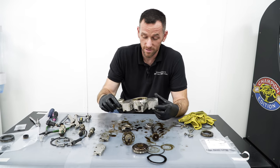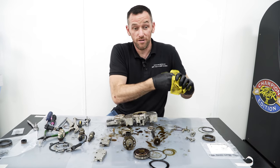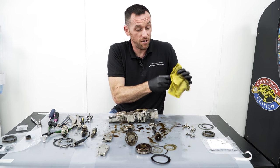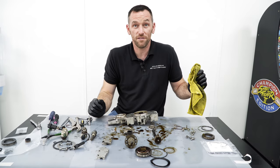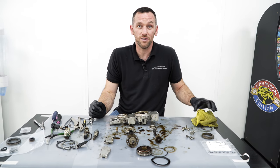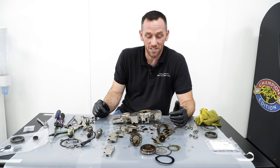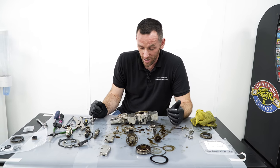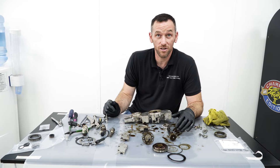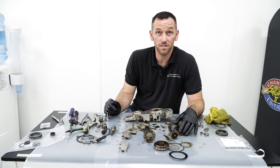They were cheap at one point. They were incredibly cheap. I remember doing these and people spending £1,000 on the VANOS unit and they were selling the car for three. And you think about it now, trying to find a £3,000 M3 Evo is impossible. You might get half an engine now. As a result of that, people got them and didn't look after them, didn't change the oil, wondered why they were spinning bearings, wondering why they were leaking oil. It's a shame, really.